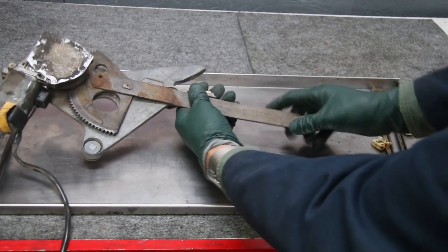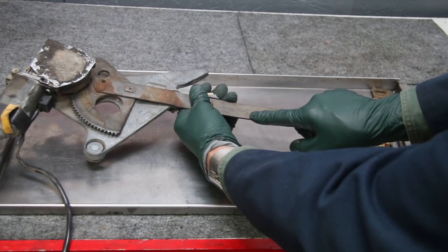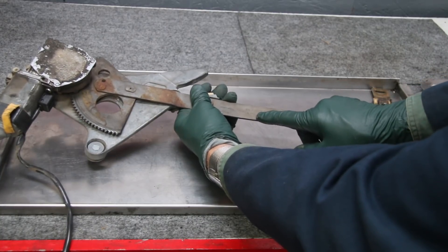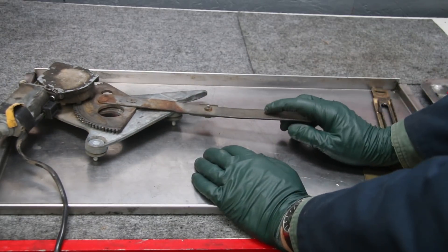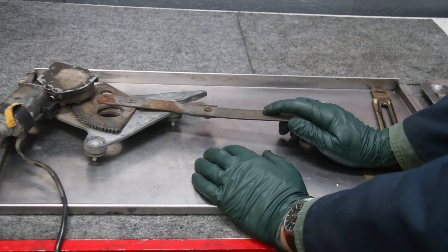This will give you a clue. Look at the part number here on this W123 regulator — it says 116 730 2246. And that's exactly the same part number that was on the one I pulled out of the 300SD.